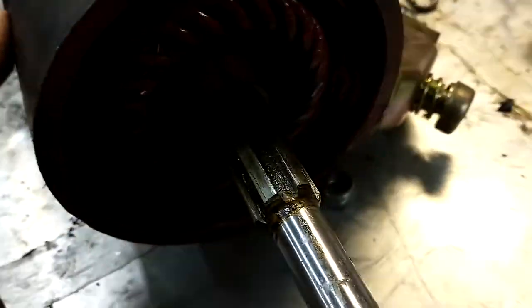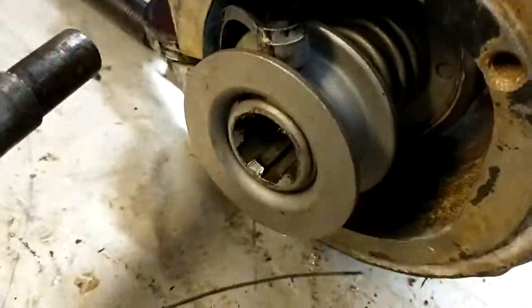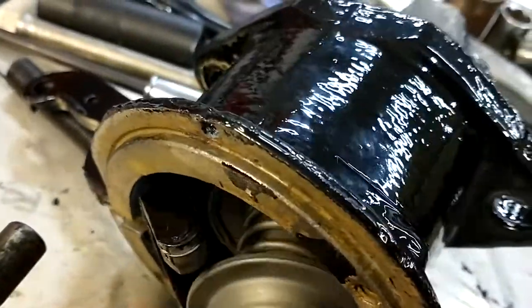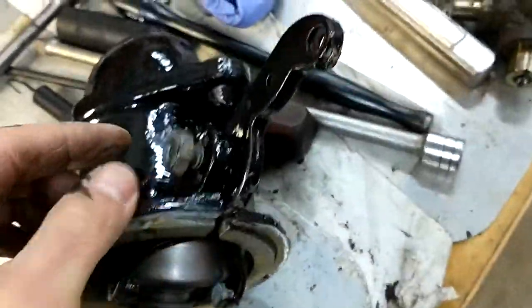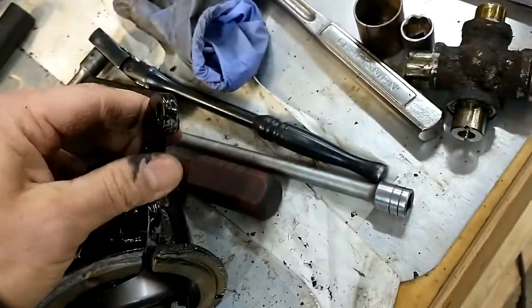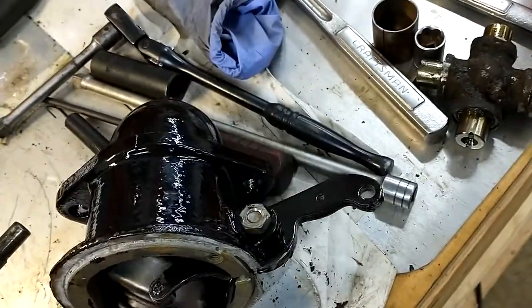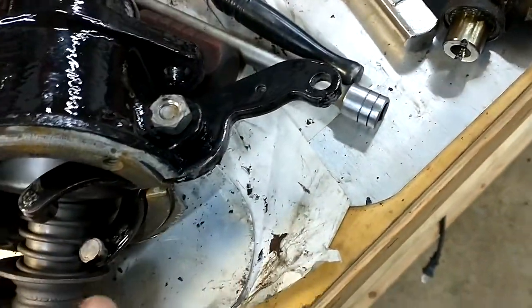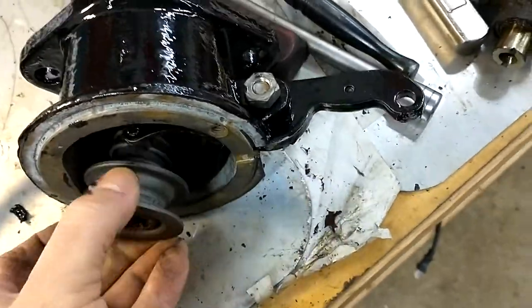You don't touch any of the electrical — you don't have to undo the brush screws or anything like that, you don't disturb the coils. It's purely mechanical. Once you can see the new one in there, to get it out all the way you have to take off the little push pedal piece, otherwise the bearing kind of gets in the way. But that's just one bolt — you take that off and this whole unit comes out.